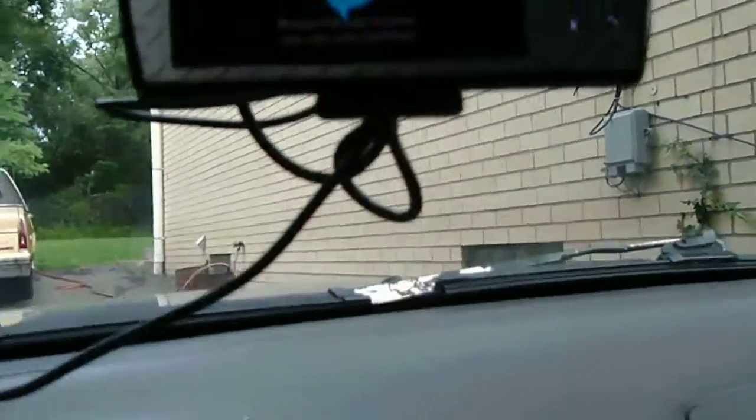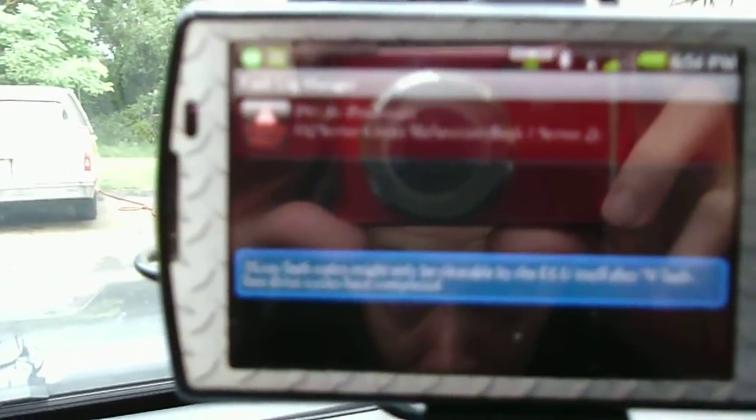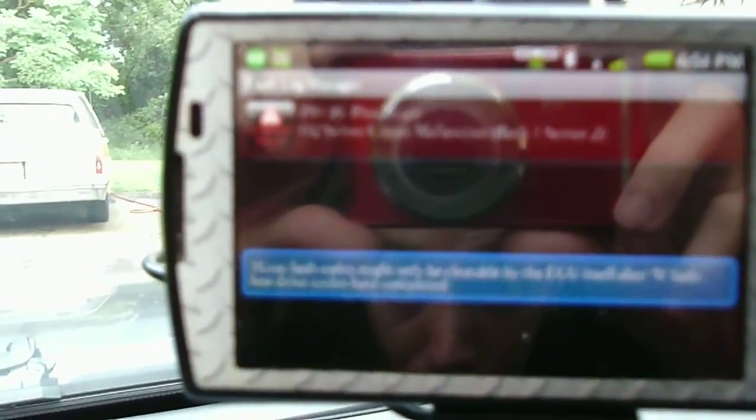We're at 94% — getting there — and there we go. There's one fault code: this is the P0136 error code. It's the O2 sensor malfunctioning on bank 1, sensor 2.